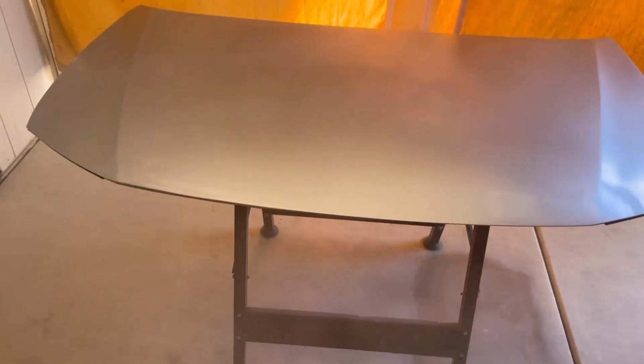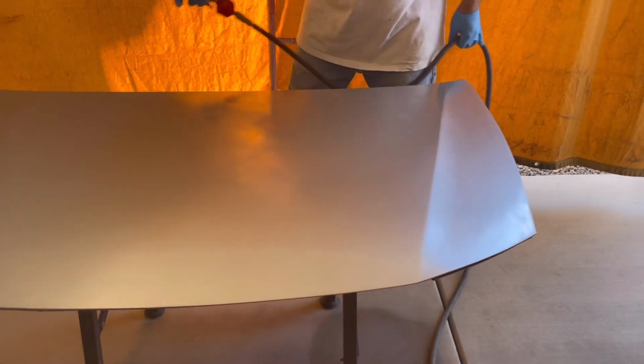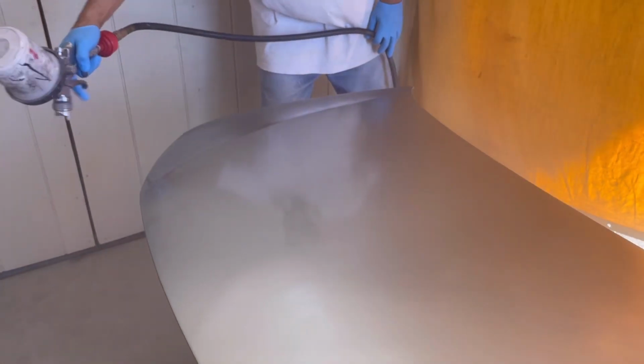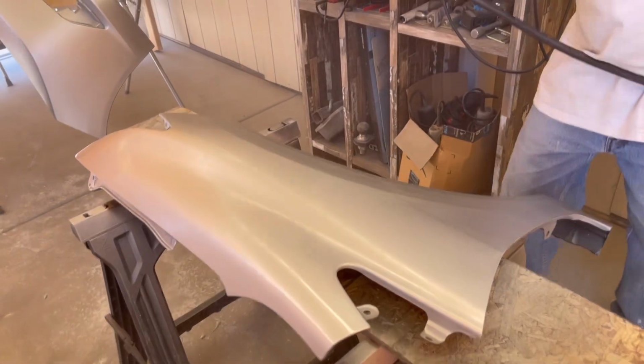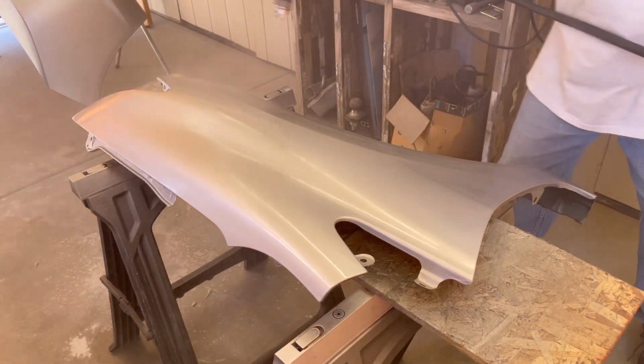We're using the same gun, Harbor Freight gun. I just cleaned it really well, and my flow pattern, distance from the gun to the panel, everything, I kept everything the same. Kept the gun moving. I had a nice fan pattern, and using these products, which I saw body shop repair collision shops using, I just copied their technique, and it was very successful on spraying this clear coat. Luckily I didn't get any runs, and just kept a consistent flow.